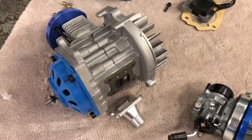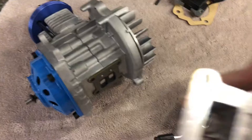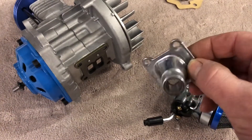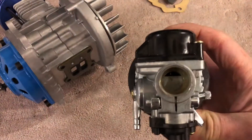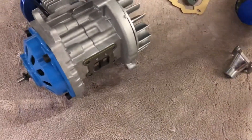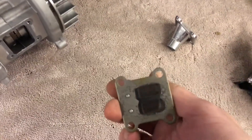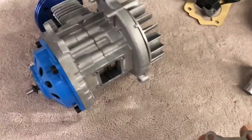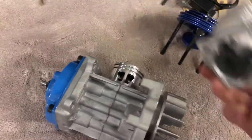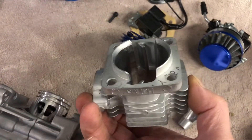A quick strip-down of the Minimoto engine reveals a very small hole through the manifold — it's got a 12mm bore, so that's pretty small. It looks impressive with a big filter but is rubbish really. The reed pack is a new tiny little reed that's obviously restricting the induction. Everything comes off; I'll take the rings off the piston. It's already got some very strange ports right there in the piston to separate the ports.